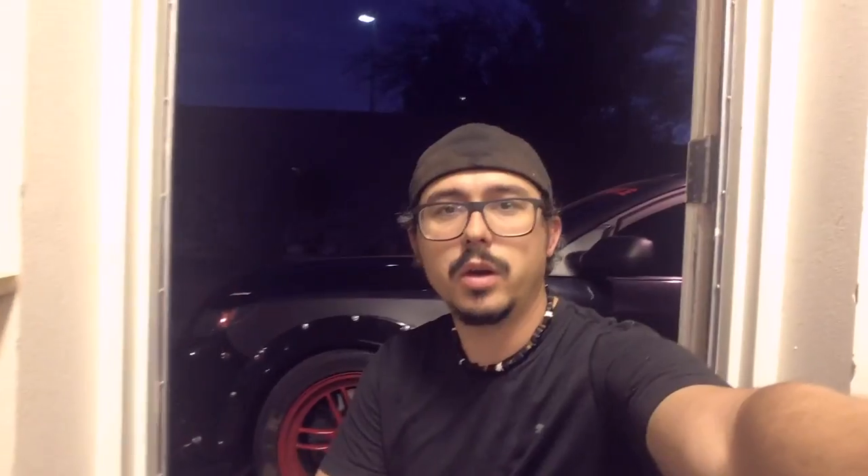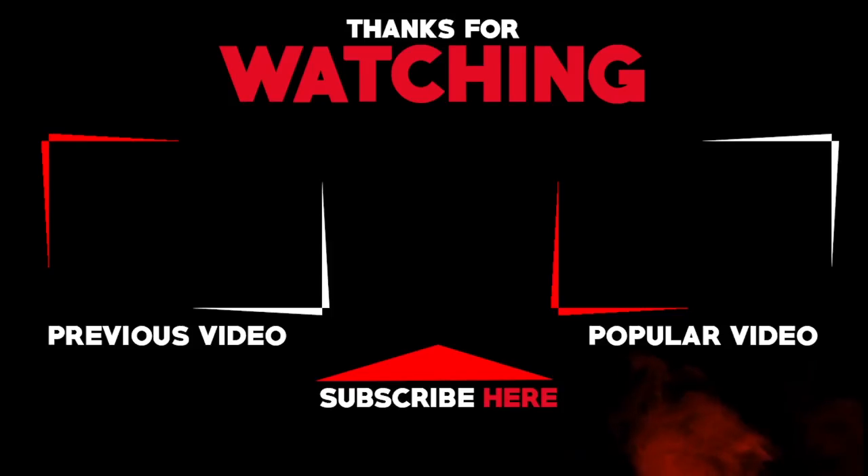Alright guys, that's it - I hope you enjoyed the video. It was a quick one. I hope it helped you a little bit on how to do your fenders. It's very easy to do fenders on these cars as long as you have a closed enclosed garage. Make sure you clean the surface very well, clay bar it, have a razor blade, a squeegee, and lots of alcohol to wipe things down. Keep it a dust-free environment - I prefer washing the full car completely, making sure it's spotless, then put it in the garage. We're gonna do the hood next on this car so stay tuned for that. I'll see you guys in the next one, thanks for watching.